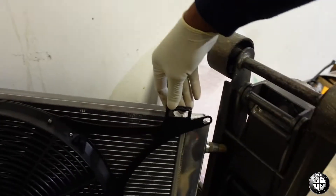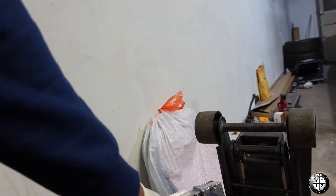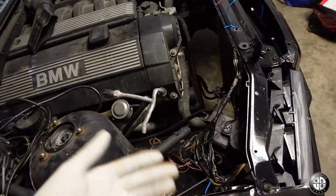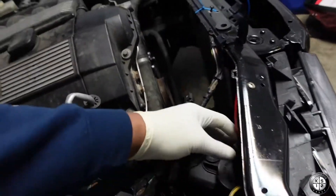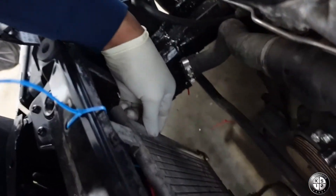Look at the quality of these parts — it's a metal bracket that the electric fan mounts up to, and it has a bracket for the coolant reservoir. You guys saw what I had rigged up — I don't think that would have ever worked because the reservoir was zip-tied in the wheel well, way too low. And another reason I had to replace the radiator was the trans cooler — I had that zip-tied up to hold it in place. See how firm that is even with the radiator out? It wasn't moving, but that's still not the right way to do it.